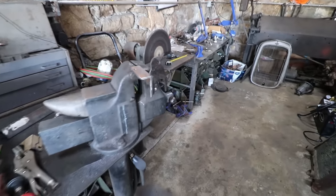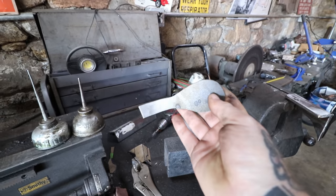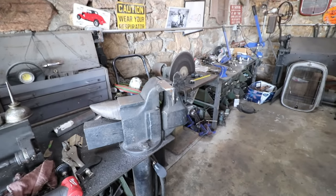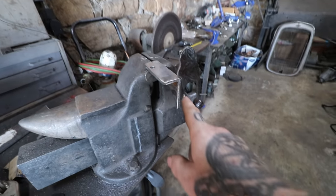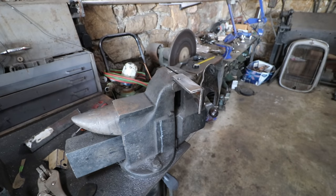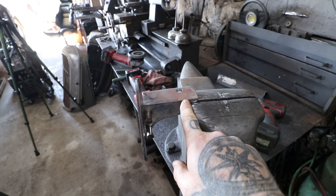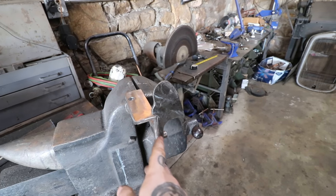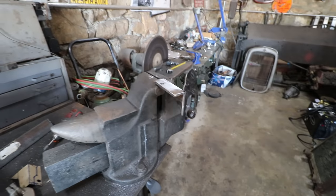After a little bit of cutting and sanding, I have two of the pieces. I ended up having to make this out of three pieces — I have a third piece here that's just rough cut with the Eastwood metal cutting scroll saw. I have two pieces here put together with some magnets. I drilled the hole on top, and these odd-shaped brackets are made from multiple pieces. I started with a piece of quarter-inch 90 channel, drilled my locating hole that's going to bolt into the bottom through the bell housing mount. I'll tack this at 90, two little tacks, and then test fit it.